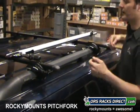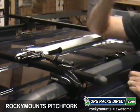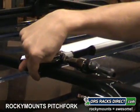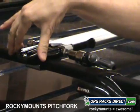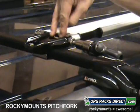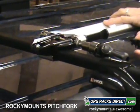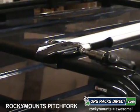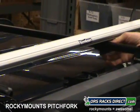The way that it attaches, by the way, it's got this little cover over here that you remove, and there are two bolts that attach to the lower mounting plate, which is sort of hinged or clasped to the front end. So you basically attach it to your bar, you tighten down these two bolts, and it tightens that plate up against the underside of the bar, nice and secure. And then you throw the cover back on, and you are done. There's a rear snap-around to clamp onto the rear bar here.